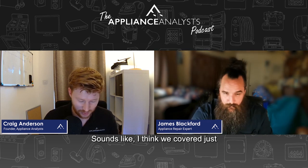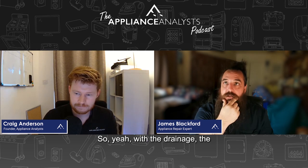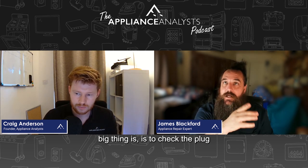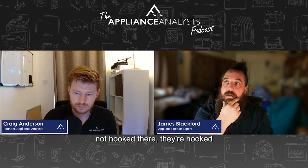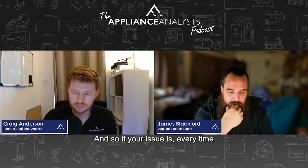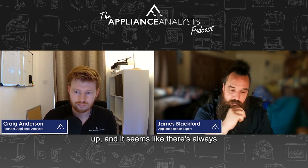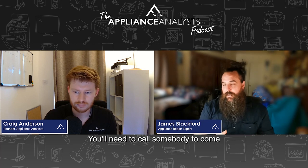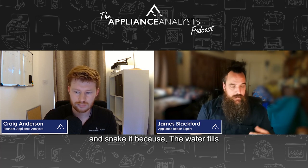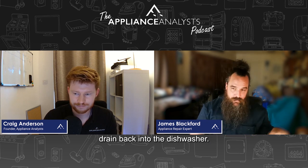And yeah, sounds like we covered just about everything. Maybe drainage? With the drainage, the big thing is to check the plug on the garbage disposal. Most dishwashers, if they're not hooked there, are hooked to a drain line on the sink. If your issue is every time the dishwasher drains, the sink fills up, and it seems like there's always some water left in the dishwasher, you've just got a plumbing issue. You'll need to call somebody to come and snake it, because the water fills up in the sink and will eventually drain back into the dishwasher.